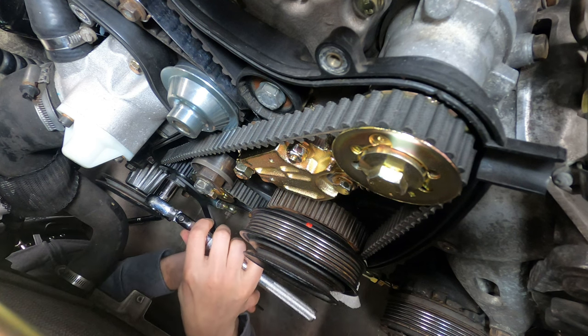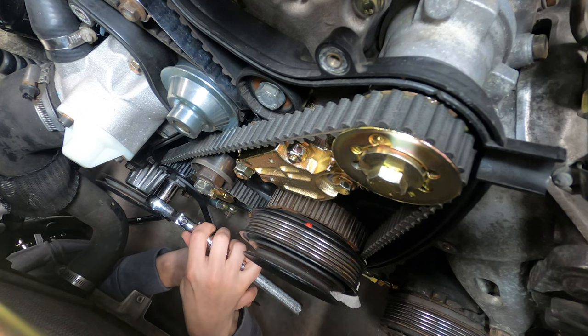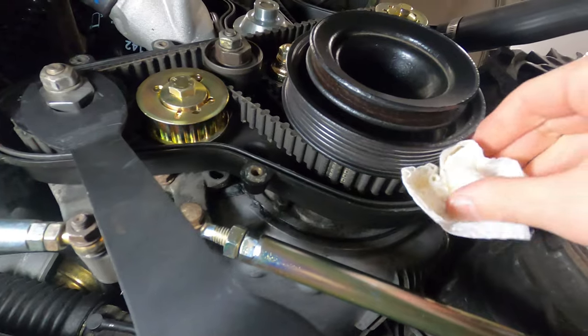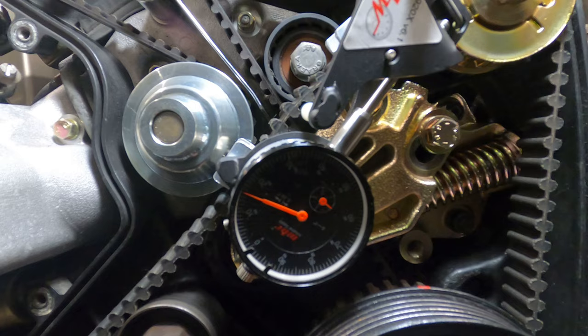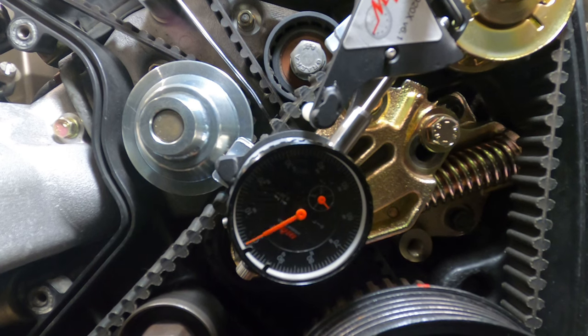And so an initial tension is set on the roller, testing a 90 degree twist on the belt, and you can remove the towel. And now the belt is properly routed and ready to take a reading on the tensioning tool.